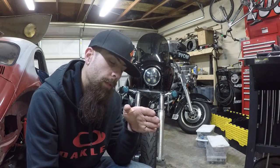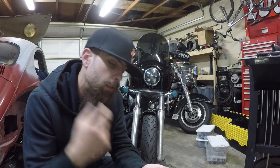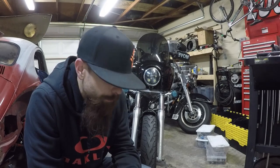of went over the carburetor, cleaned it all out. We went through the progression holes. You start to open the butterfly and there's a set of holes in there. And so we pulled the pilot jet out and got some carb clean and jammed the straw in there, sprayed it out. I covered the holes so that I could try to get a spray out of each one individually to make sure that all the passages were clear. And I was really hoping that was going to be the fix.